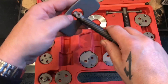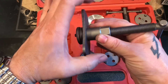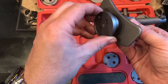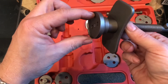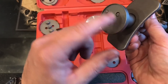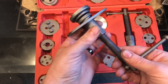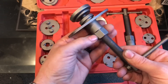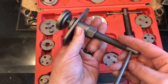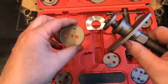This piece right here slides onto that, and then this butts up against the caliper. Then you put your adapter on depending on what you're working on — this goes against the caliper piston, and this goes into the notches. Sometimes there's one notch, two notches, or just a slot. Then you wrench this up so it's nice and tight against the caliper, and then you wind your caliper in — that's how these things work.